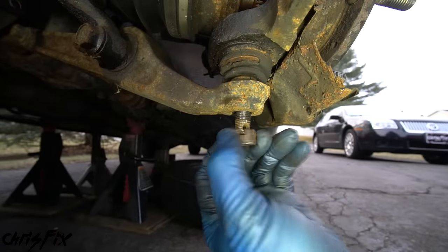Tape off where the bearing and ball joint slide in, then start with a special silver-colored paint that bonds to the rust and seals the metal surface so no new rust can form. After that dries, go over it with a special thick black paint that adds a second barrier against rock chips, brake dust, oil, and grease — it's also going to make this wheel well look really nice. Follow the same steps for the knuckle and strut fork: paint on the silver-colored paint, and after that dries, paint on the thick black paint. With our wheel well and chassis painted, that paint barrier is going to prevent rust. Let it dry for 24 hours.